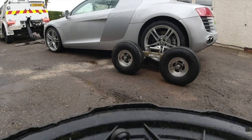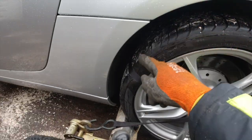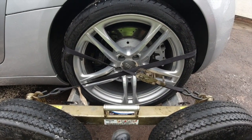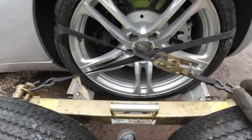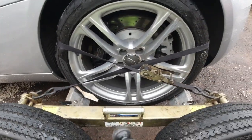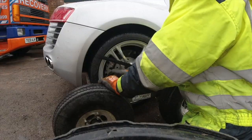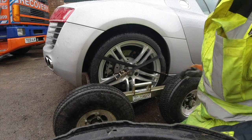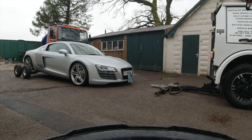That is the dollies set up. Now it's time to strap them down and then lift up the front end of the motor. Go around the back of the tyre, up to the front and across — nice and tight. I do recommend that you recheck these after even a couple of 50 to 100 yards if you go over a pothole, because they can bounce and come loose. Now time to do the exact same on the other side — nice and secure again.